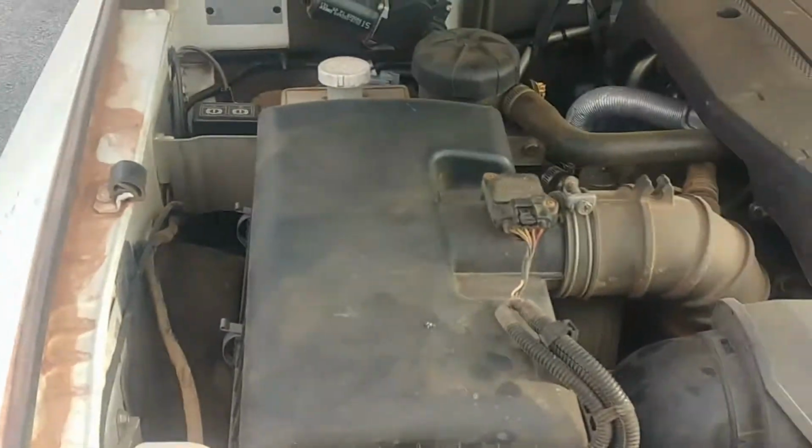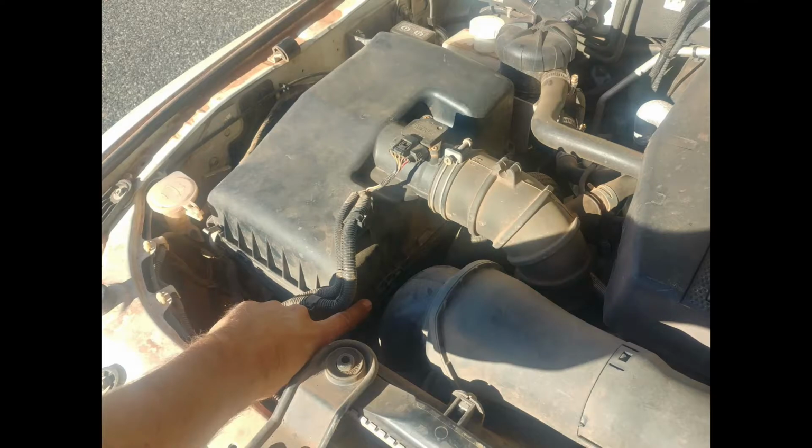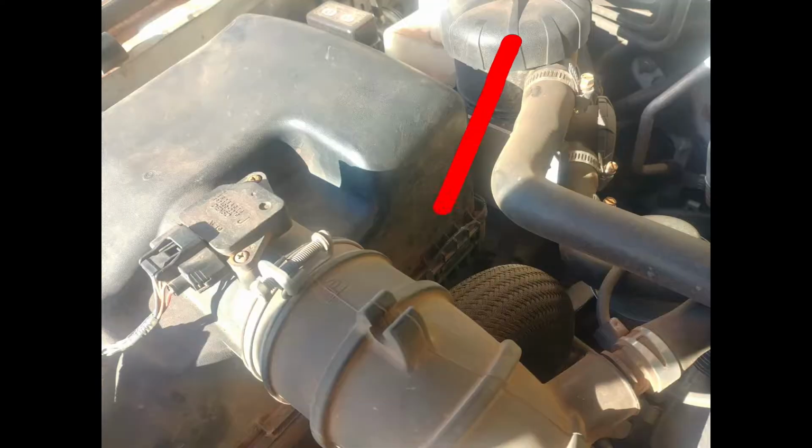If you've got a Gen 4 Mitsubishi Pajero, a common problem is the loud resonant rattle that comes from the airbox. I've put 3 Ryco filters through this vehicle and have had the same problem every time. The rattle is caused by the top half of the airbox vibrating against the lower half, particularly around the 2 catches on the engine side. And while you can jam various shims in between these 2 halves to stop it rattling, they do sometimes fall out or get lost if you forget to remove them before checking the filter.